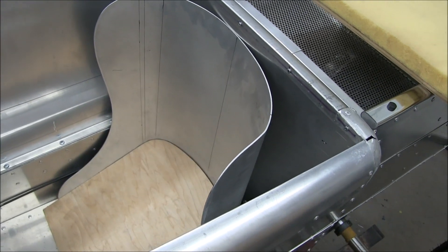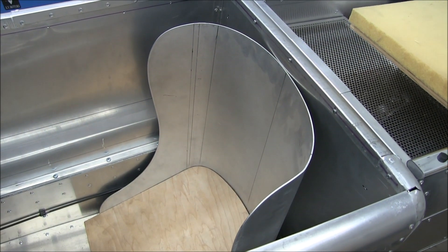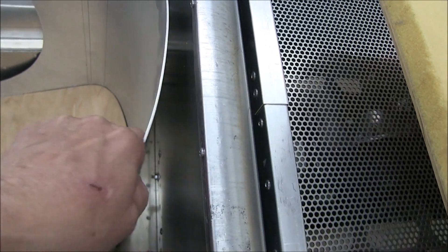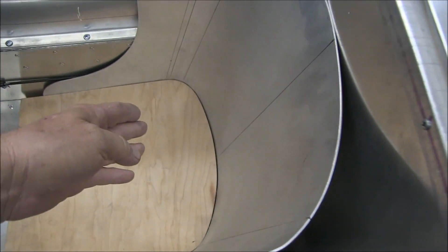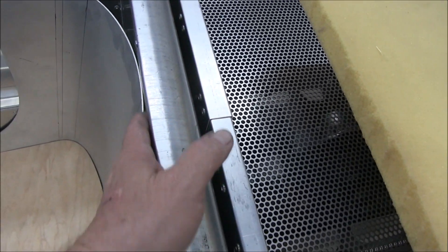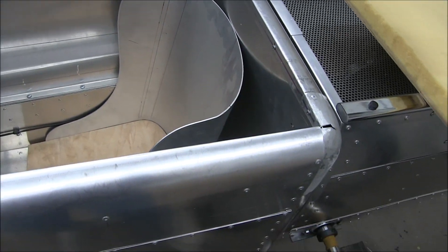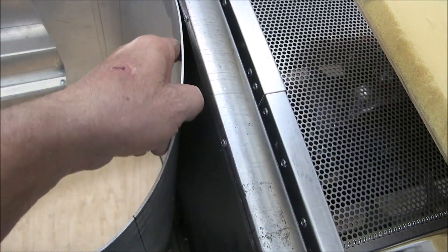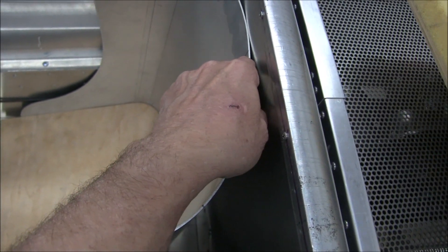If you recall I made this seat back when I built the running chassis, long before the body, and I made a slight miscalculation. Because the back is slanted it pushes the seat forward and then the pedals are too close — I didn't take into account the back wall, which wasn't a problem when it was just an open chassis. I want to use it, so my plan is to cut it so it's upright, straight up and down, cut that bottom part off, and then make a new seat bottom.